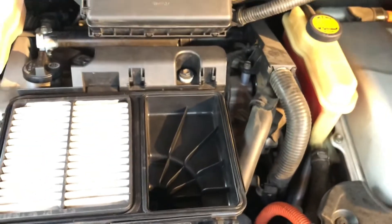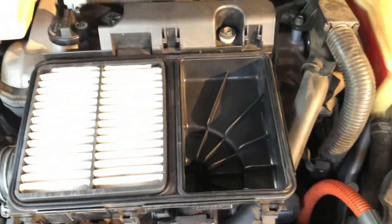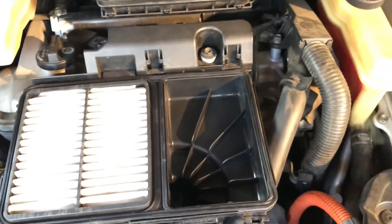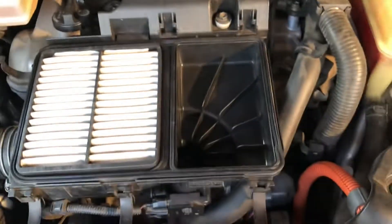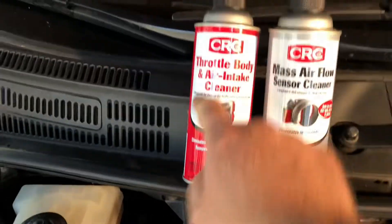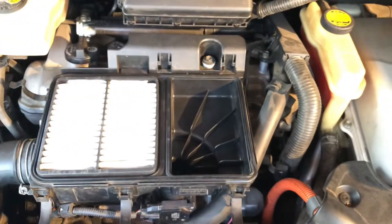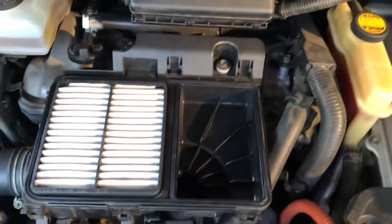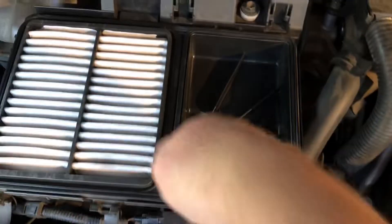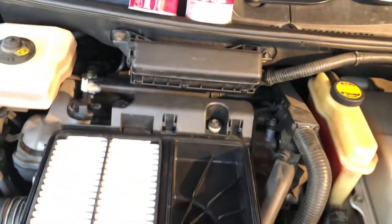What I did differently — I went on priuschat.com. This bottle says just to spray it down everywhere, but it didn't feel right with some liquid down there near the engine. Other videos say to use a toothbrush to get all the black crap off your throttle body to make sure it closes completely, and that kind of worked. But what I found was best: I used blue paper towels — don't use regular ones because you don't want anything getting in there. Some people on priuschat said rip up an old shirt, tape it to a stick, spray the cleaner onto the shirt so it gets nice and wet, and really go to town. I found that much better than spraying directly in there. I first sprayed it directly, it didn't do anything — still super dirty. So I did some elbow grease with the shirt and blue paper towels, being really careful not to drop anything in there. That's how you do it.